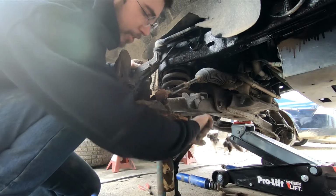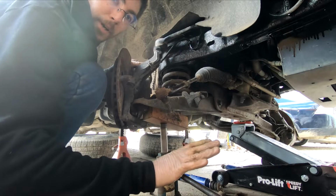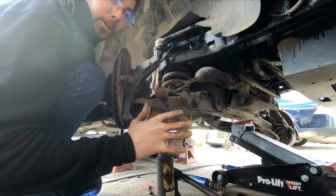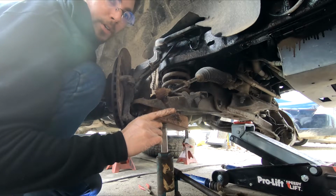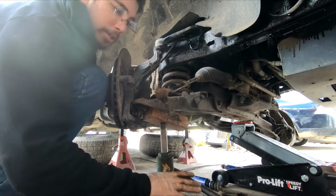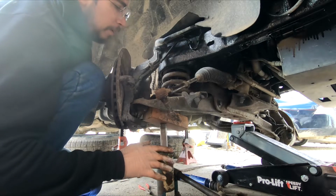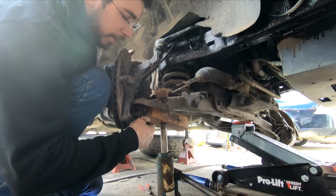Yeah, we've got to come up just a little more. Now, that was the critical point. You need to be paying attention to the rest of the vehicle. If you notice right then, the entire truck just moved, which means I'm now jacking up the entire truck on this one jack. At this point, it does you no good to jack this up any further. You've hit the ultimate of your compression. So at this point, no matter what, we've got to brute force this out of here.